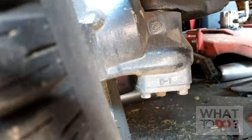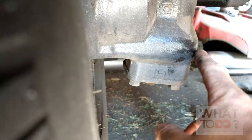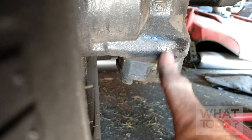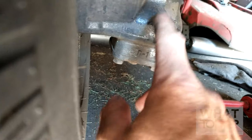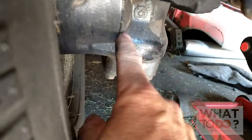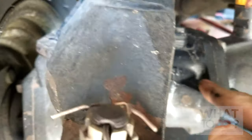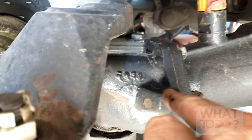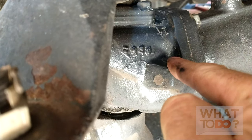We'll take a look at this one because this one seems to be okay. Now this is your bevel gearbox here. The other one has a crack in it - all the fluid leaked out. The bearings broke inside of here - this is the whole unit, it's a bevel gear case that we had to take off. Up inside of here this piece had to come off as well. This is another gear case which holds a bigger gear. The bearings in this had went bad, so we've got a little bit of a job ahead of us.